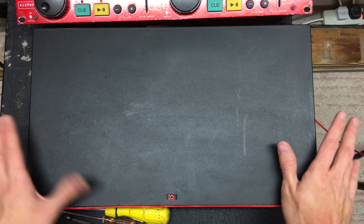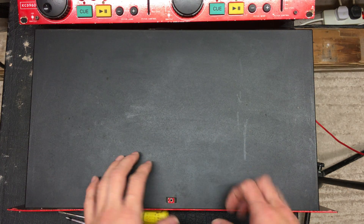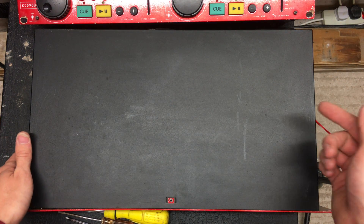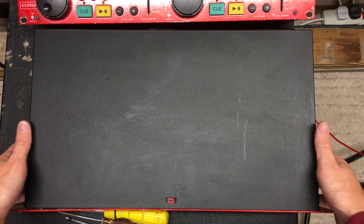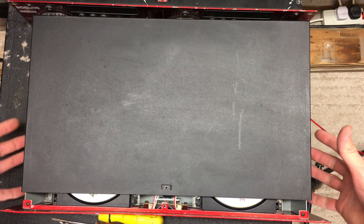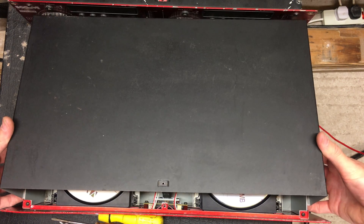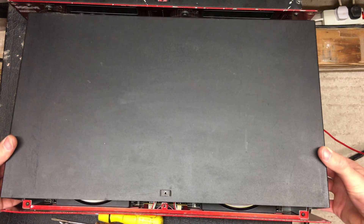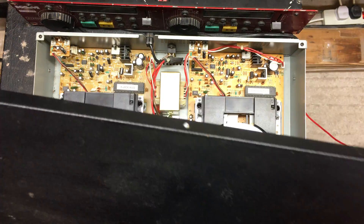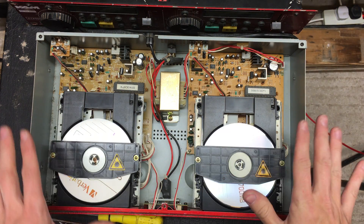I've taken the screws out in advance. I've also shot another video showing you how to fix sticky trays, so look in the description or on my channel for that. Once you've taken the screws out, slide the tray backwards like that just so the tab comes out, and then get your fingers under the front bottom of the tray — you have to sort of lift it on some of them because it wraps around underneath — and then just take it off. That exposes all the inner workings.